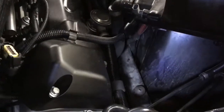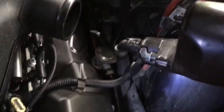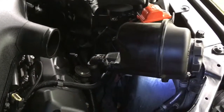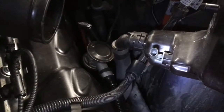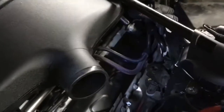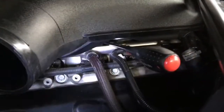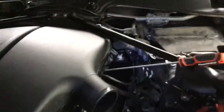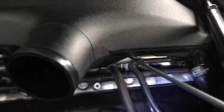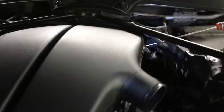Next, remove the lower air filter box tray, just lifts up and out. Then you want to lift the expansion tank up and over, and it'll just flex over nicely on the hoses. Disconnects the level sensor as you come up and over. It'll give you a bit more room around the other side. 8. Number 9. And lucky last, number 10.